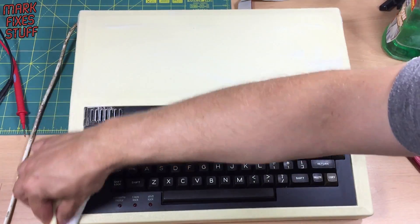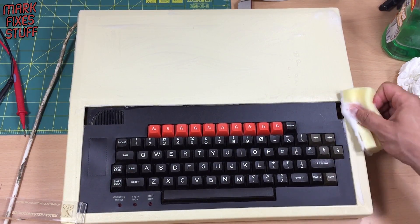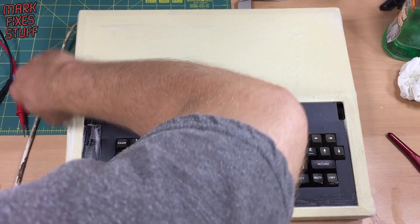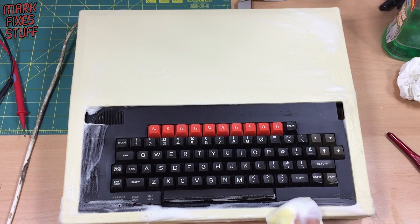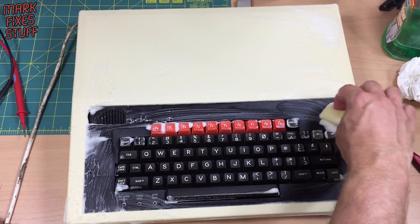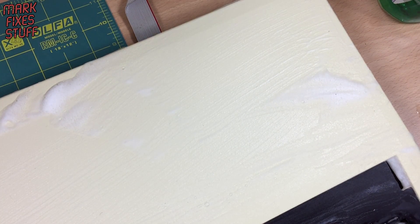This is just a little bit of washing-up liquid on a very soft, not very abrasive washing-up sponge. I find this a really good way to get these plastic textured cases a bit cleaner. What happens is dust settles on the case, then humidity increases over summer — they're often stored in lofts — so they get slightly damp, the dust gets wet and adheres to the top case, season after season for actual decades. As long as it's just a foamy sponge you're okay. Don't literally saturate anything — water and electronics don't mix. Kitchen roll afterwards to mop it off.